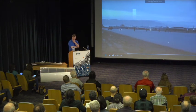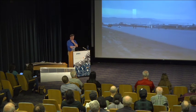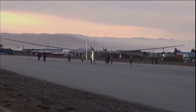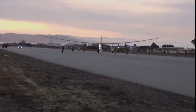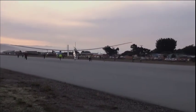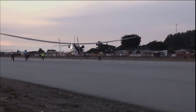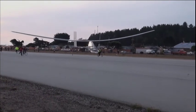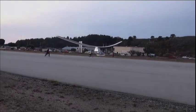I thought this first flight was going to be maybe a little 20-meter hop. I was going to be happy with that. And when I actually took off, I found that it flew really easily, so I felt like I could go the rest of the length of the runway — we're about a third of the way down the Half Moon Bay runway. But you'll see I wasn't able to do that. Notice that I start to kind of porpoise here a little bit, and I realize that was pilot-induced oscillation. I actually pulled myself out — I was flying it, I let off on the stick, and you'll see that the plane actually trims out really nicely.